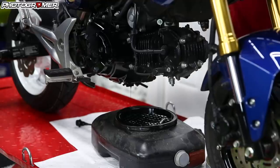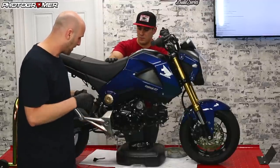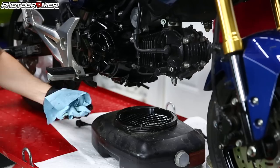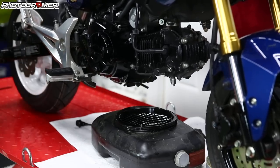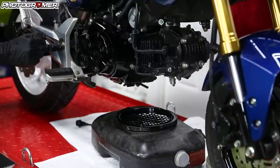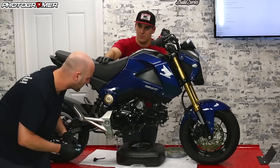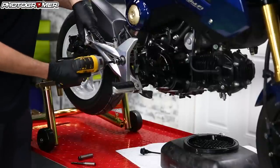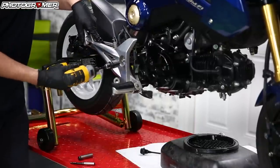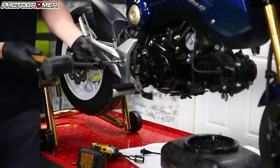With that being said, we're going to put the oil drain plug back in, because it's very easy to forget to put that in when we fill it up, and then we'll crank the side cover off. I just hand-tighten the oil drain plug — that's good enough. Now we're going to remove this bolt here, tuck the rear set away because that's going to let us get the clutch cover off a lot easier. This bolt right here is the motor mount also, so just tap her through.